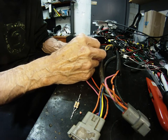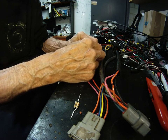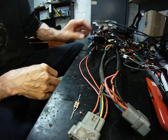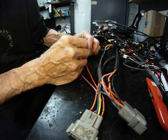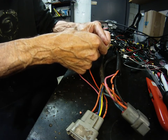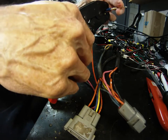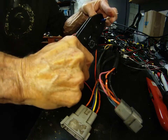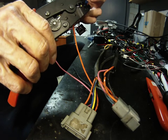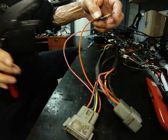Now we take one of these and place it over here. Then we place our resistor in here and crimp it again. Blue side for this one — for the wire and the resistors. Red side for this one — a little bit tighter to get on the resistor legs alone.